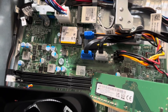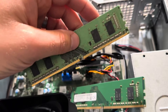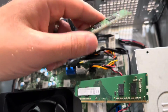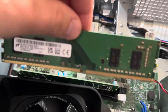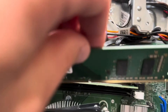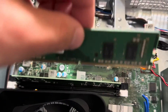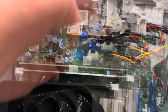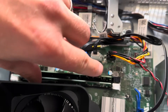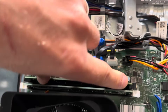But it's an office desktop, so it doesn't matter. The most important thing is that we're going to get 16GB of RAM and I already had this stick. Most importantly, put it in correctly — one side is longer than the other and we have this divider. We just put them in the slot, they are placed correctly, and we push. And it closes.